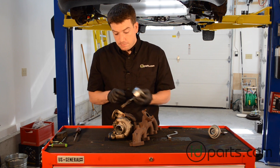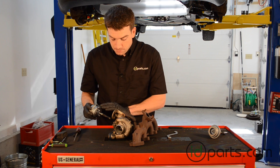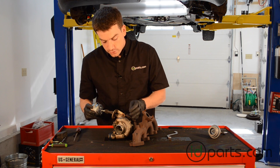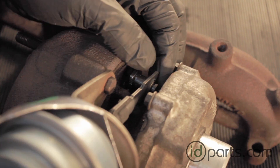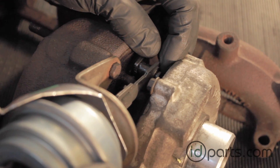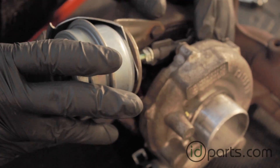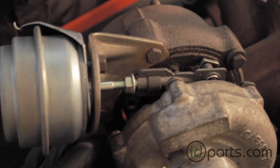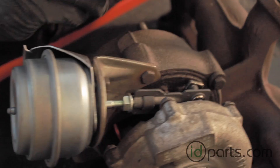With those in place, we'll go ahead and put the actuator on the turbocharger bracket. When we do that, we want to line up the bracket with the exhaust side of the turbo — this bracket is kind of like a heat shield, and the exhaust side is going to be the hotter end of the turbo, so it needs to protect it from that. The first thing we need to do is catch the arm of the actuator on the vane lever, then line up the two studs and push that into place. Once we're done with that, we'll catch these two nuts to be sure the thing doesn't fall off. Then we'll take the turbocharger actuator circlip and slide that on over the arm.